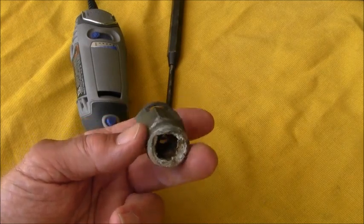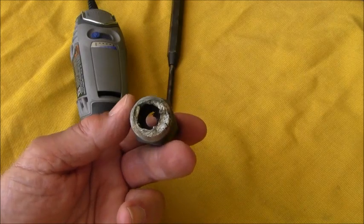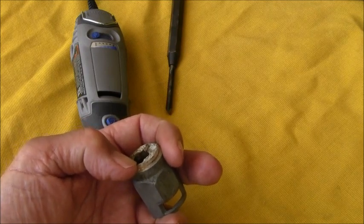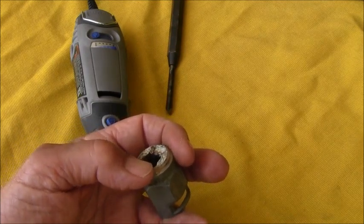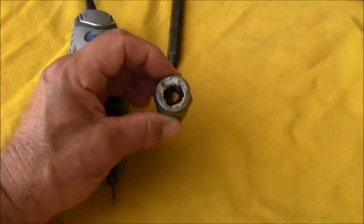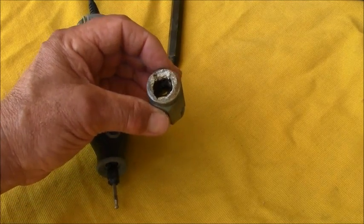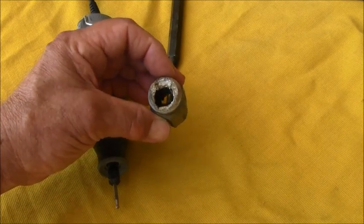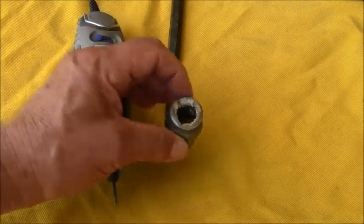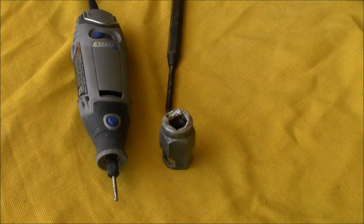I had to take off the air cleaner and move wires out of the way to get to this. It's a pot metal fitting screwed into the aluminum manifold, and it was broken off flush with the top of that manifold. If you've ever tried to do work on something like that, you know the challenge. I tried working on it with a small chisel but it would just crumble — you couldn't do anything. So I attacked it with a hacksaw blade, thinning it down to fit inside.